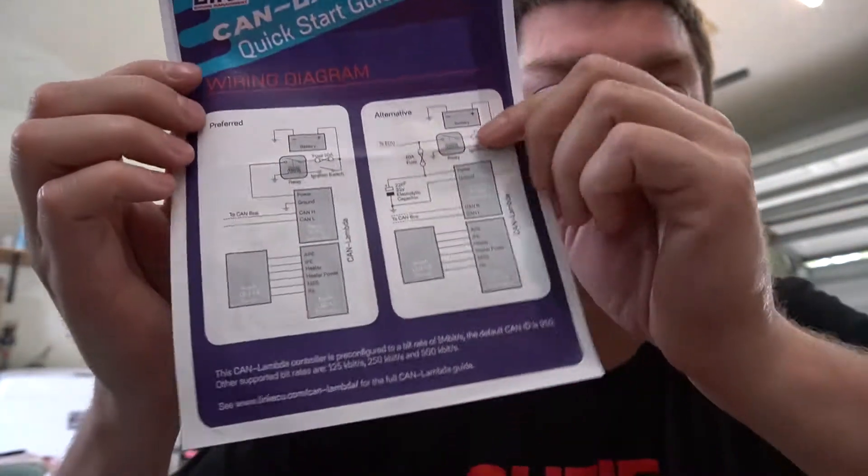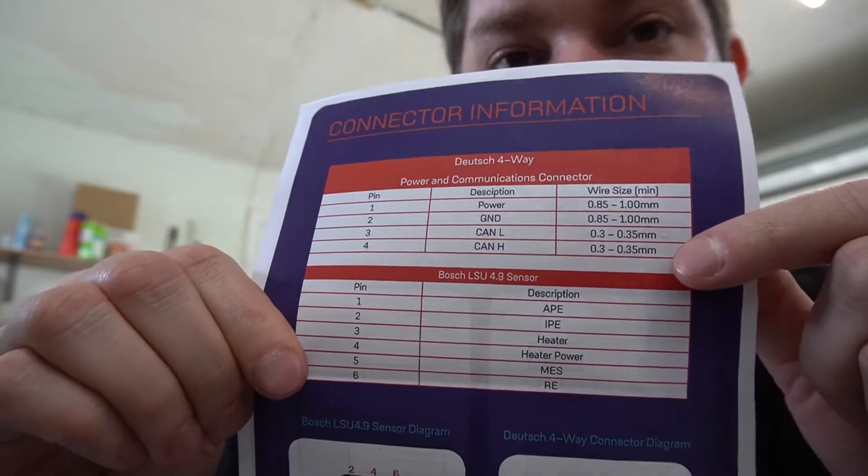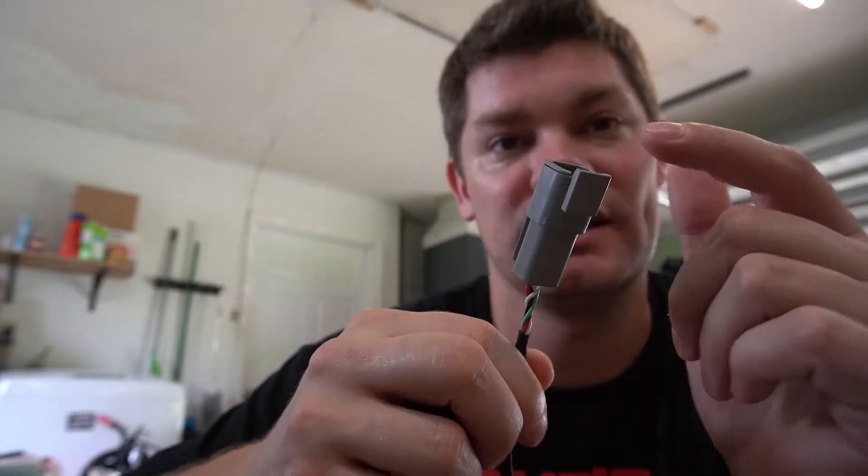So that's what I'm doing, that's what's going on. I have to get this new item hooked up and installed before the Link ECU actually comes in. The downside is I actually have to do some wiring and pinning that I've never done before. You have this little guide and all these different pins that I have to solder, and with this wiring diagram you have to follow, I have to wire up these four pins for power and the CAN signal. Creating this kind of connection — I've never done it. It seems easy, but there's a lot of little components inside.